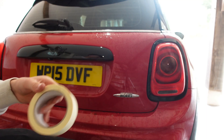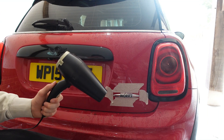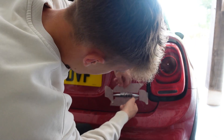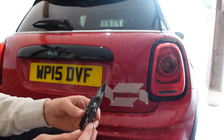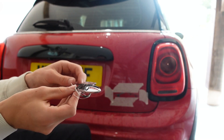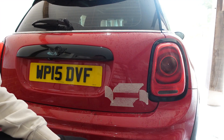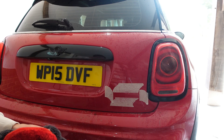Masking tape is very important - that is it marked up now. Heat it up first to make the glue a bit gooier so it comes off easier. Quite a bit of the glue came off but there's still some left on there. Hopefully this one comes off a bit easier. There's the old badge all off - it was looking a bit tired anyway. Now it's time to peel off the rest of the residue. That has now come off really well - literally no glue left and a really nice smooth surface, ready to put on the new one.